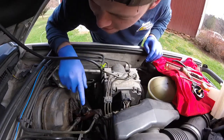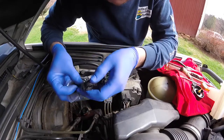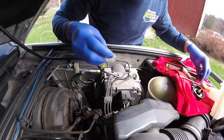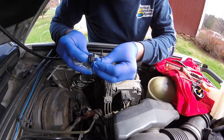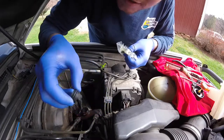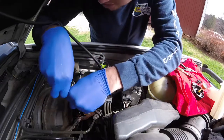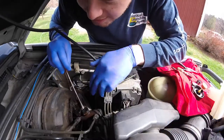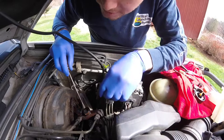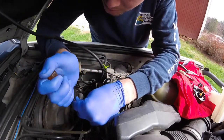You can see here these are my two grommets that need replacing. In my kit I have this funky-shaped one with a little opening — that's for the inside one, the one closest to the pedal. Then I have this other one which appears to be the same on both sides, but I'll double-check. You have to handle this carefully, not because you'll break it but because you don't want to slosh brake fluid around — and you can actually see the cracks in the old grommet.